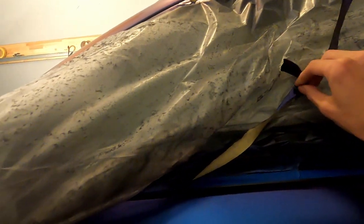As the plastic dip ages, you will see it start to peel back in those areas specifically, because it is not as protected. So after you're done with all the peel when wet areas, you can go ahead and wait 30 minutes for the coat to dry, and then peel the rest of the car.